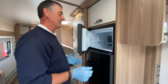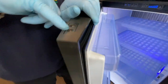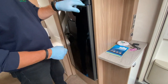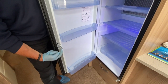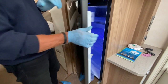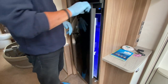The refrigerator unit has a separate freezer box above and the fridge below. This is the travel catch — pressing it down operates the claw. For normal use on site, I can push the tag up to move the claw out of the way, relying instead on a magnet to hold the door. To re-engage the claw, just push against it to press it back down. The same process applies to the freezer above.